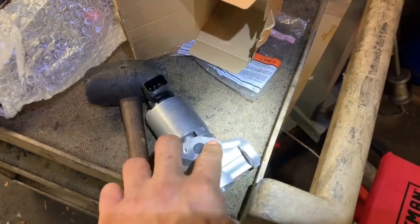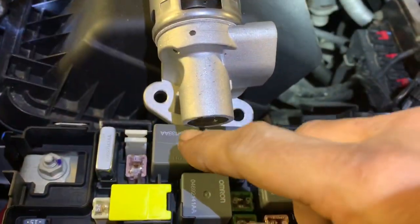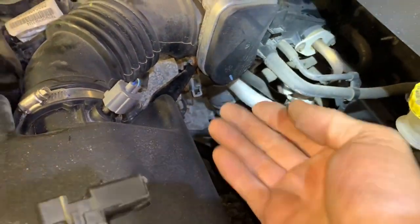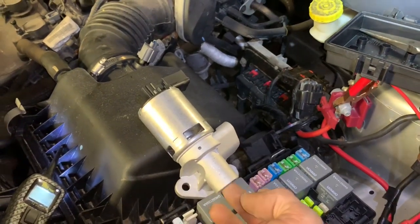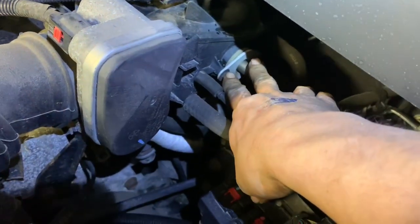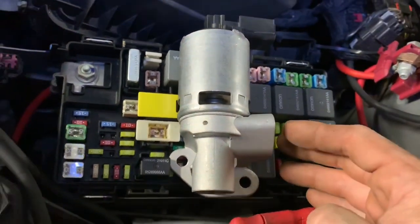Our EGR valve looks like it's got two screws that go in here. More than likely, this is the tube that goes in, and this is probably where it bolts to the intake or the cylinder head. It looks like we've got a fitting that screws onto the bottom there — that's probably going to be our problem child. To make this process simpler, we're going to remove these two bolts here on the line that connects in, so we don't have to worry about getting that screw out right there, and we're going to remove these two bolts, then the line will still be connected and we'll remove it while it's out of the car.